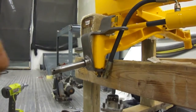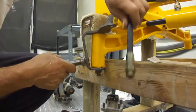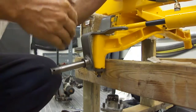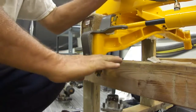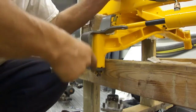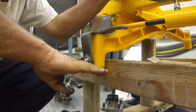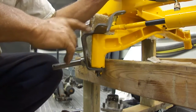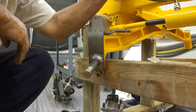Now that bolt is tight and it moves freely — that's just what we want right there. That is beautiful. So now the tire is perpendicular to the way it's supposed to be. Before, when I put these on, the top part would lean forward and the bottom part would lean out — it would cock up this way with the wheels at an angle. So now I have the wheels straight. It automatically lines itself up. Without that, I just had a lot of slop and play.